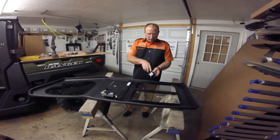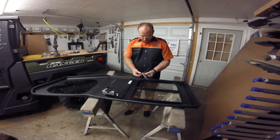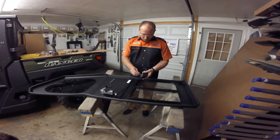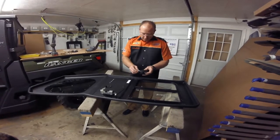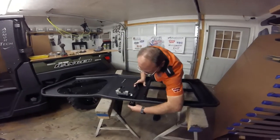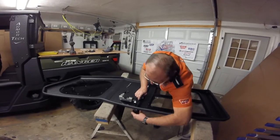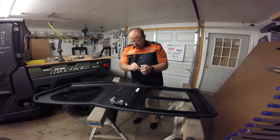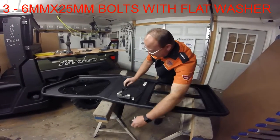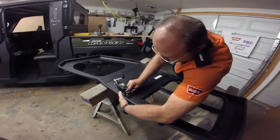To install our door handle, there's going to be bag 10. There's a six-millimeter by 25-millimeter bolt with a six-millimeter nut — it goes in your handle right where what I call the peg extender is. Put that in about a quarter of an inch, then check to make sure it will hit your pad and release it. Back it out just a little bit. Take a 10-millimeter wrench, snug down that jam nut, then take three of the six-millimeter by 25 bolts and go ahead and bolt your handle in.